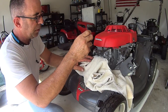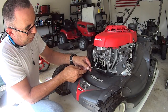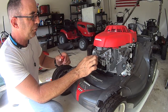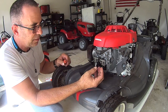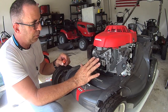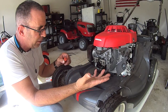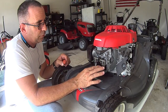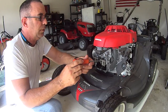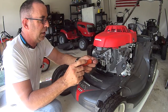When you're doing the sides, scrape down, and when you're doing the bottom, scrape down. Let it fall down. You don't want this falling into here. It's not going to hurt anything because it's kind of like rubber, but we don't have filters on these little machines, so you don't want any debris in your oil. It's not going to get caught in an oil filter; it's going to be circulating around. So use a towel, even a paper towel. I would rather you use your wife's washcloth.